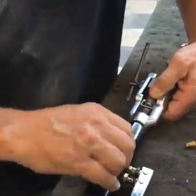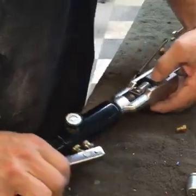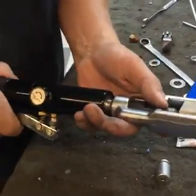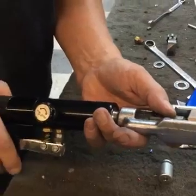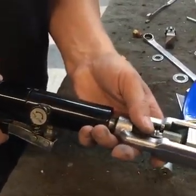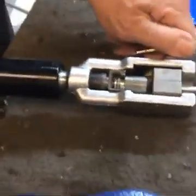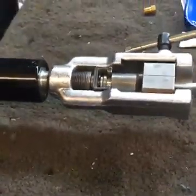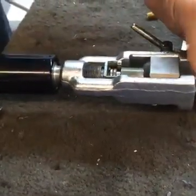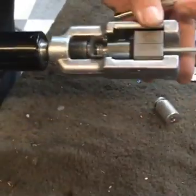It's also a law. The law that it's double flared? Yep. It's the law of common sense, probably. Weren't they single flare back in the cars back in the day? Well, I think so, it could be. We've seen some cars come through here that are single flare. And that will have a tendency to break in the flare. I think it's worth a little extra time to show you what it's going to look like both ways. I'll put the single flare on here.